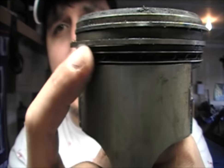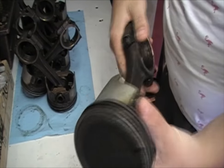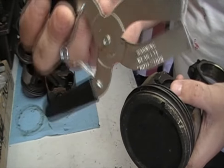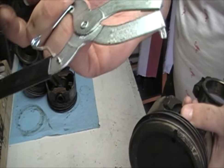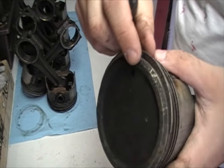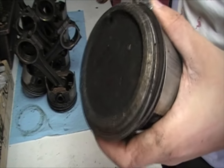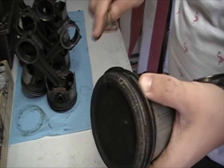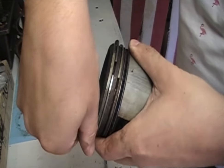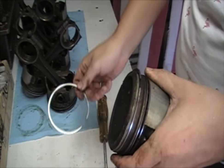I'm going to show you how to take these off now. A lot of people say you have to have a special tool, which I have right here — it's a piston ring installation and removal tool. But you don't really need that to remove them. All you really need is a flat blade screwdriver. Get the ring opening around to you and just push it off to the side without scoring the piston, then push it out and around so the other side of the ring comes free. Then you've got your ring off — set it to the side.